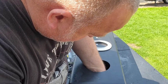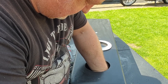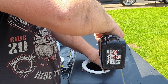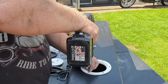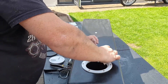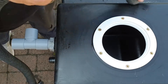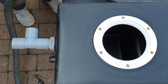I've even put a little bit on the thread of the nut so when it's in position it should hold nice and tight. I didn't wait for the sealant to go off — I screwed it down straight away hoping it would squash into all the places it needs to be. Once it's secure, it's just a matter of cleaning up any excess. I'm hoovering out all the swarf from inside and tidying up the job. While we had it on the bench, I've also glued a T-piece in position ready to accept all the pipes coming in.